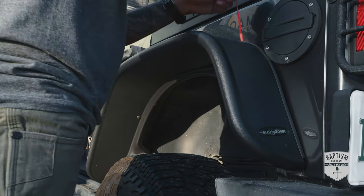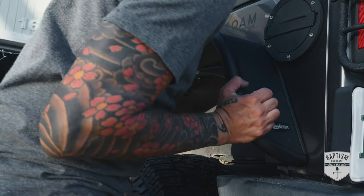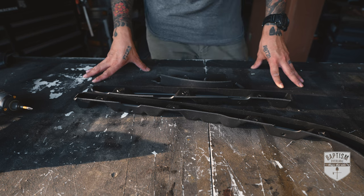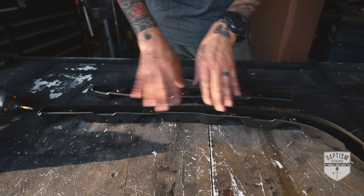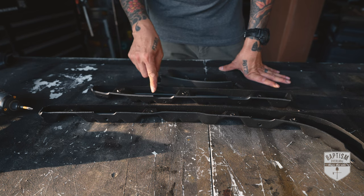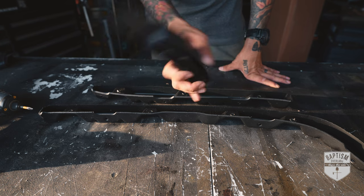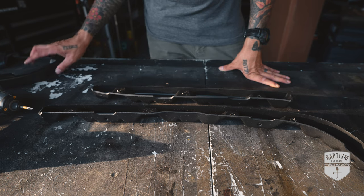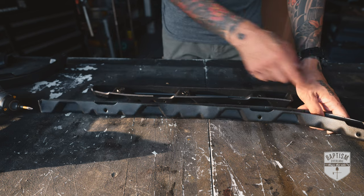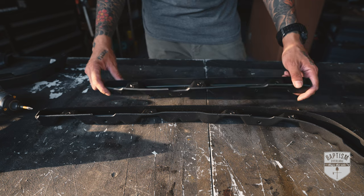With the fender screwed on, you can now peel the rest of the adhesive off and press it up against the vehicle, making sure the gap is closed up nicely. Moving on to the front — pretty much the same exact process. Go ahead and take the inner brackets and put those clips on them. This time you're looking for D1, D2, and D7. D7 you can put aside because there's nothing to add clips to, but for D1 there are clips here — one, two, and three — and then four, five, and six on D2.